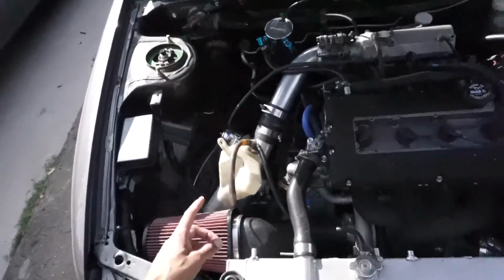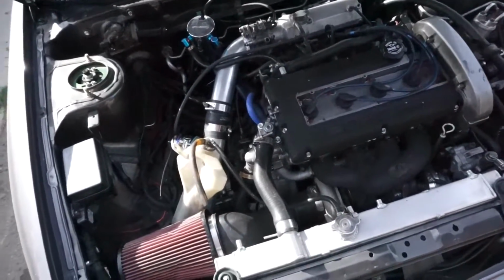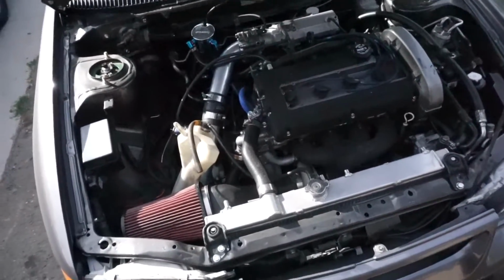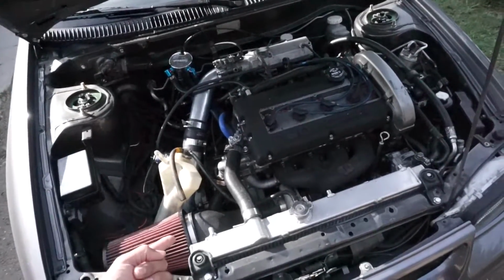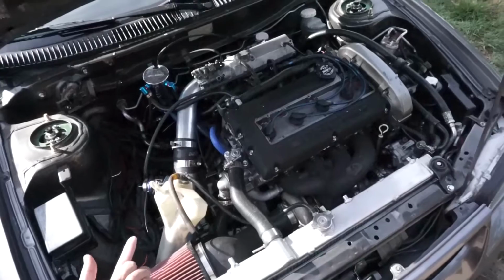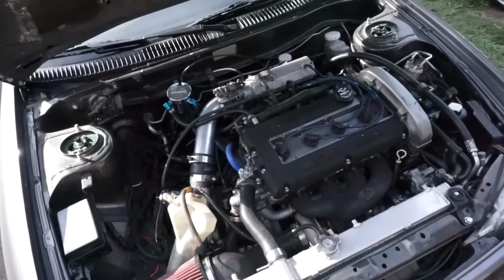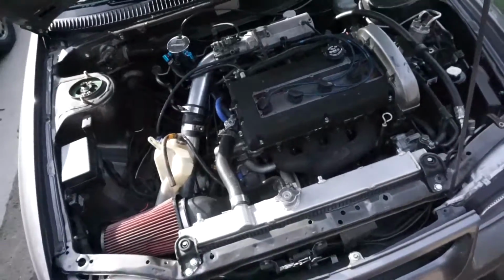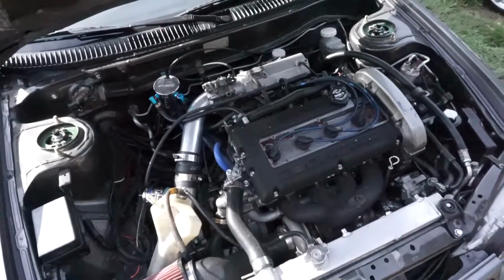The reason being is the clutch won't engage, and the reason for that is I ordered an all-wheel drive flywheel by mistake. I have a 106 tooth front-wheel drive flywheel that I used to have on here, and I was assuming they were the same thing. It's not that it won't start, because the diameters are, I believe, half an inch smaller. I think it's how far out the flywheels sit. So I'm gonna drop the trans, pull the flywheel out, and compare it to the one I have, and go from there, because I got a new clutch master and a new slave and bled it, and it still doesn't feel like it's right.